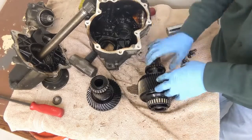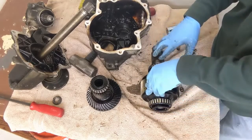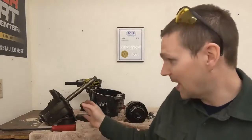There's not a whole lot to these — that was kind of just a quick, simple teardown of what's inside a transfer case. Couple of bearings, couple of gears, couple of seals. That's what's inside a 2005 Hyundai Santa Fe transfer case. It's interesting that the TSB says that if you can't fix that input shaft seal leak to get a new transfer case. But what I take away from this is that there are internal seals that can be replaced. So before you condemn your transfer case completely because of that input shaft seal, pull it apart, try to get that inner seal replaced and see if that solves your problem — maybe it can save you a few hundred bucks.